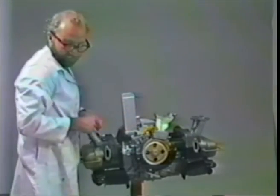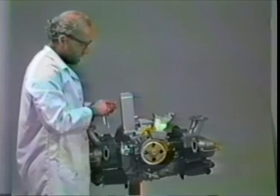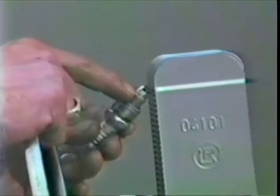I like to try the Bosch Platinum plugs on these things, but so far we haven't had a Platinum plug that works. So if you are stuck for plugs, the right type of plug, the ones I like to use, are a W200 or 225 T35. That's the old number. It has the extended tip plug, tends to advance the spark a bit. On Super 90s, I have a supply of the T7, which are the side electrode. Very neat plugs, and I'll show you them maybe before this tape is over with.